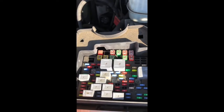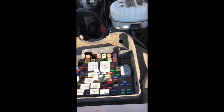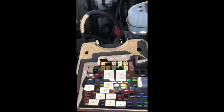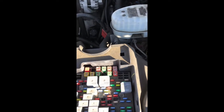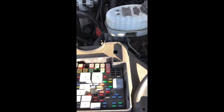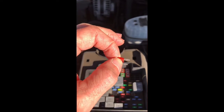When we start the car the computer should attempt to reset all the different step motors. There's a whole bunch of them in the car, but that usually gets rid of the clicking problem and usually gets rid of the problem with not getting cold when you want cold or not getting heat when you want heat. It kind of resets and recalibrates all the step motors back into their proper position.